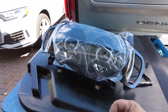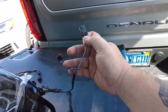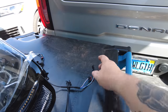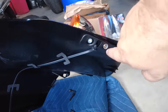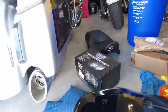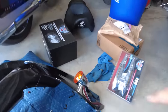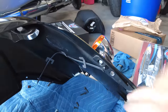Now, let me change out the bullets. All these lights plug in line with your existing harness, so if I was just doing this, the ones I unplugged earlier up top would just plug in line — no wiring, snipping, soldering, or nothing. Now we'll do the conversion on the actual fairing. All you're doing is this one bolt there holding this on. Once that's off, you just unclip that wire. You're going to use some electrical tape just to secure the wire to the back of the inside of the fairing. This bullet has exactly the same backside as the stock unit. The bullet goes on there, bolts in from the backside, you route the wire. There's no rewiring, the harness is there, and you're done.